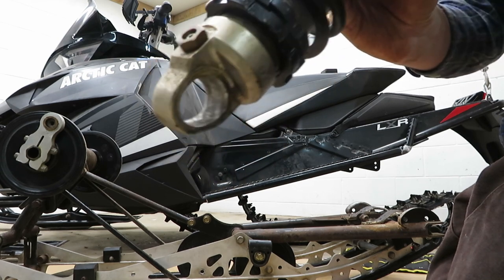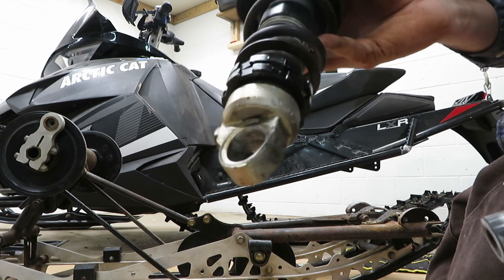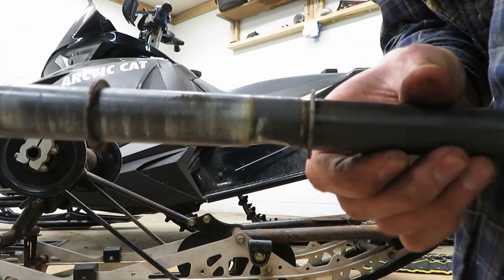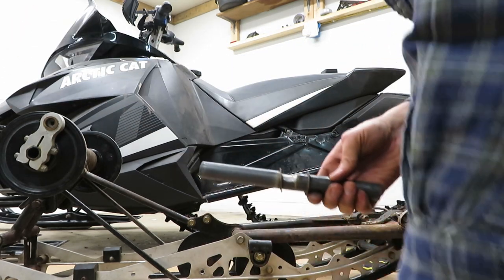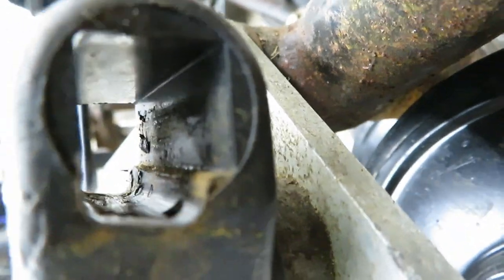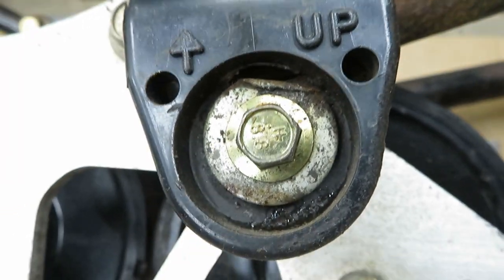I cracked something hard, and I suppose this happened over time, but I do remember hitting something that felt like a rock right at the front of the skid in the UP. I wonder if that's what caused that irregularity. I think they might be able to save the rest of the shock and just replace that piece, since it does get removed — we'll see what they say. That piece will also need to be replaced — that's my non-expert opinion. The square section machined into the plastic towards the top is where the spring rails are supposed to slide. However, they've apparently worn all the way down, so they were actually rubbing on the washer that holds that piece on.